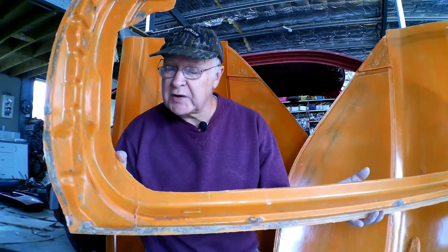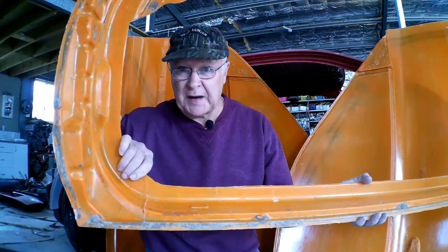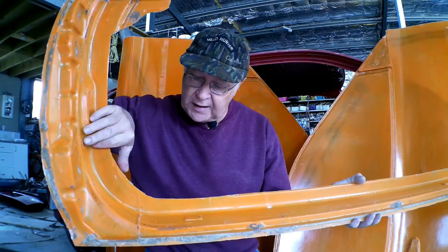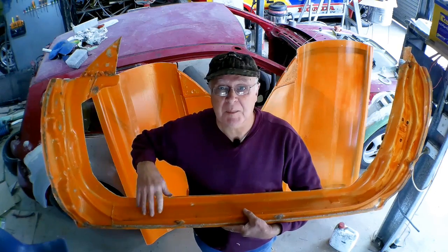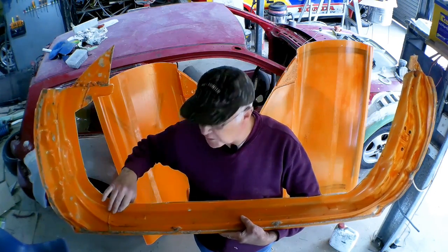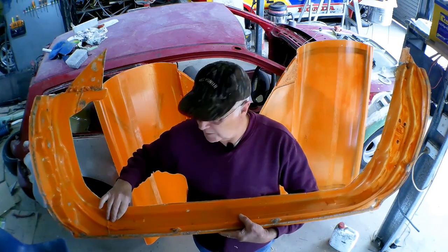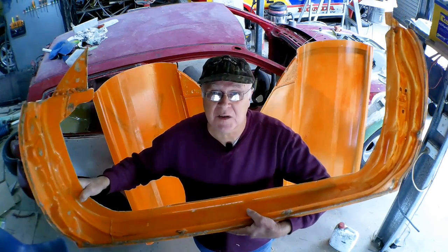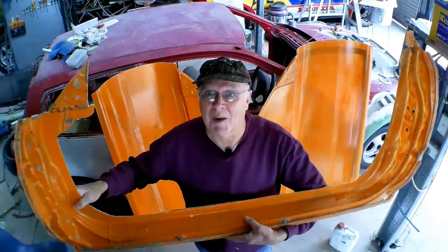This inner door frame for the unused passenger side door will not be made in carbon fibre, because that material in hand laying would not take up these compound curves properly. You'd have to vacuum bag it, and I'm doing this without that. On a shape like this for hand laying, it's best to use gel coat and fiberglass cloth. And the weight difference between that and carbon fiber on a part this size, well, it's not worth worrying about.